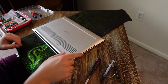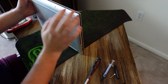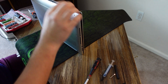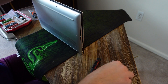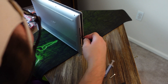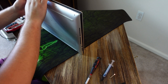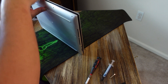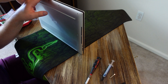With the screws off, it is time to remove the back panel of the XPS case. I found the easiest way was to poke in from the front and then pry it off around the edges. If you have a spudger, that helps. I just cut myself — it is sharp, so be careful. It is one of the harder cases I've ever opened, to be honest.